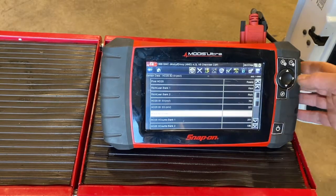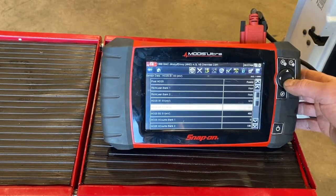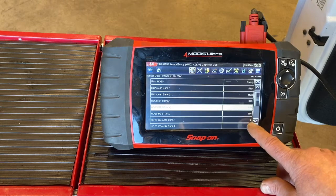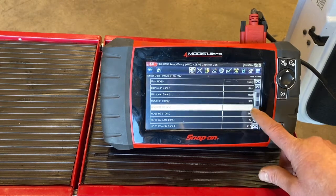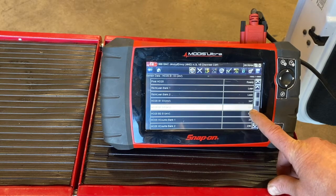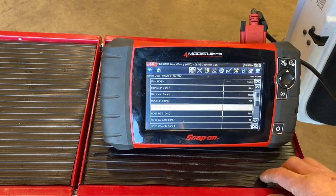You can also look at the oxygen sensors behind the catalytic converter. Right now that catalytic converter isn't as hot as it should be — it's only been running a short time. Once we bring the temperature up on the catalytic converter, those post-cat O2 sensor numbers should be fairly stable. Right now I don't like how much the post-secondary sensor is moving, but it hasn't really run long enough, so it's not fair to start blaming the catalytic converter just yet.